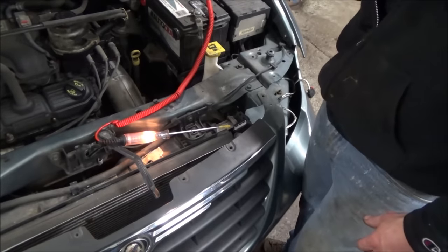I'll show you what I'm going to do now. You can see how that relay is riveted on there. We could use a big chisel bit and just smash it off, but I'm going to be a little civilized about this — I'm just going to drill that rivet off.